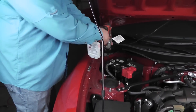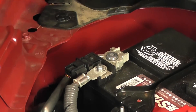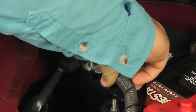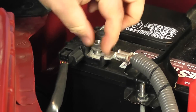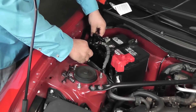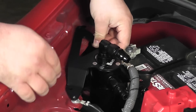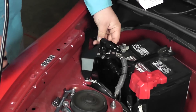The first thing you need to do is move the negative battery terminal 90 degrees. This will free up some room right here for the catch can to sit. All you have to do is unbolt it and bolt it back down. We're going to do a little dry fitting here — this bolt is where it goes, and there's a bolt back here that's painted. This fits good; we just might have to mash that down a little bit.